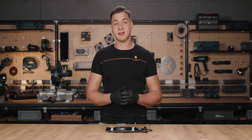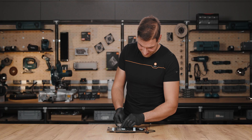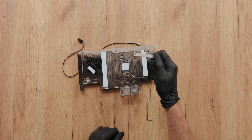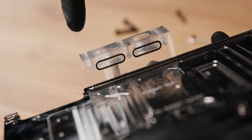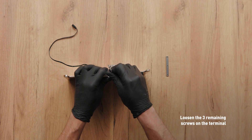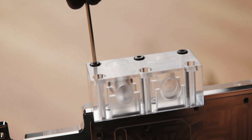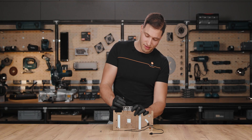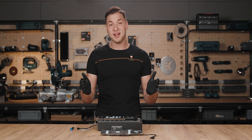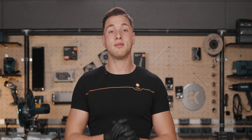In this next step, we need to remove the blocking terminal metal plate and check that the O-rings are in place. Loosen all three screws and remove the metal plate. Once you have removed it, please check that all the O-rings are in place. In order to ease the installation of the active backplate, please loosen up the three remaining screws on the terminal and make sure that they are loose enough for the terminal to move a bit — like this. Before we can put on the active backplate, please make sure that all the screw holes are aligned with the empty screw holes of the block. If they aren't aligned properly, please remount the block accordingly.